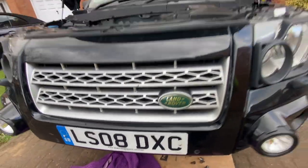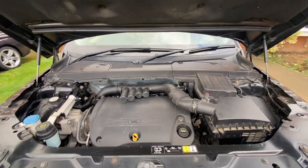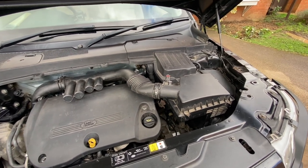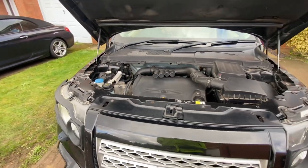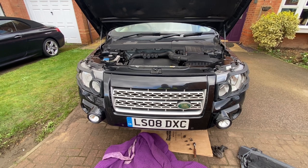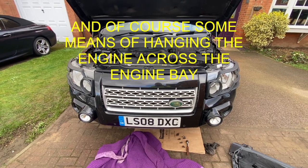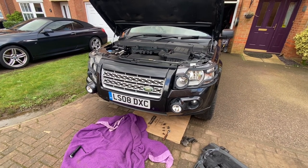The only thing I'm going to do now is get a software reset or recalibration done for the gearbox - this should have been done quite a few years ago through Land Rover and there's no record of my car having had it done. I've got it booked in to see whether it helps with the noises I'm experiencing. Lessons learned: it is possible on a driveway to swap an auto gearbox out. You will need an engine hoist, a decent trolley jack, and some method of securing the gearbox on that trolley jack. I hope that's useful and good luck if you try it yourself.